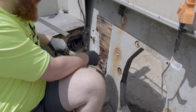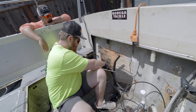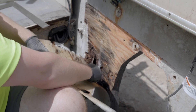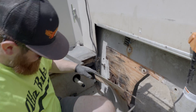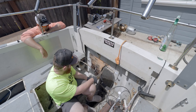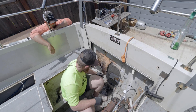This thing is just smoked. We're going to have to cut a little bit more out of the boat than we were anticipating — probably rip this edge up here to get that big motor in the back. It's wasted. Super soft. Note to self: if you have a boat, don't just drill a bunch of holes in the transom. Previous people did that. They didn't have silicone on any of the bolts, no sealant — look at that, just falling apart.